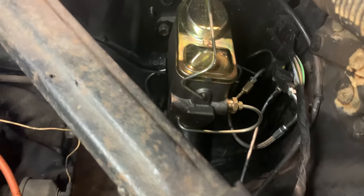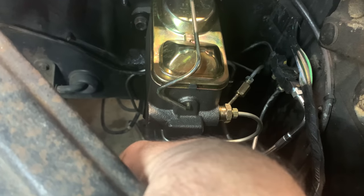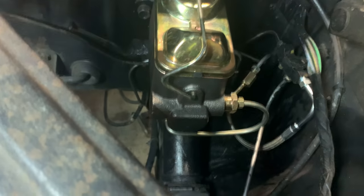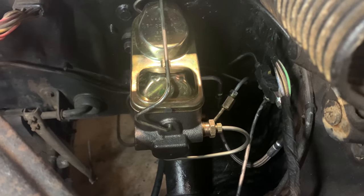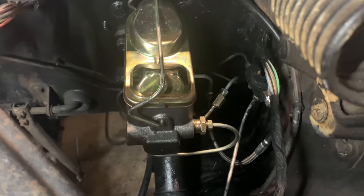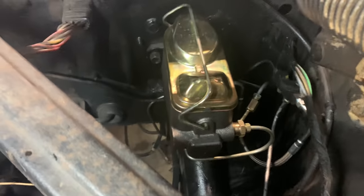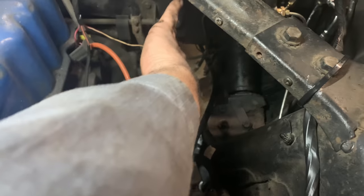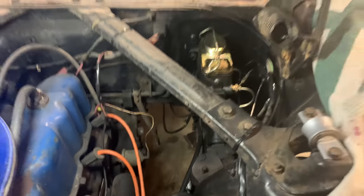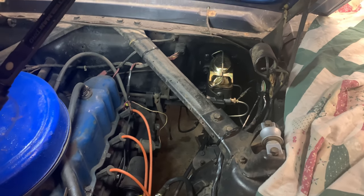You have your brake proportioning valve to the right there. The brake lines are perfectly fitted, bending around and through except for the one I talked about. There's a proportioning valve underneath where you can turn a knob to make it more biased to the front or to the back - of course we want it more biased to the front because that's where the good brakes are. It's definitely easier to do this with the six-cylinder in it, because once the V8 is in it'll be harder to access things, so it's better to do it before you put the new motor in.